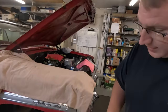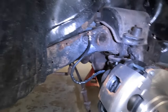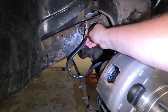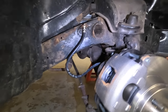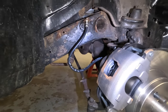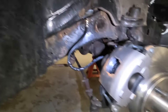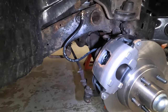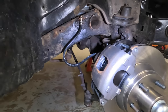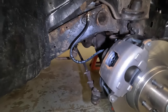Yesterday, first off, being that these brake lines are just kind of way too long. If you run these where they're supposed to be, right there, turn the light on, you can just see how much too long they are. And that's honestly a problem we've had with all of these kits so far, and that's a little frustrating to me, that they're all just significantly too long, because this suspension, the way we have it mounted with the jack stand sitting on the sway bar, the suspension's at its lowest point. So this is at full travel, and it's already this too long. So that's a little annoying.